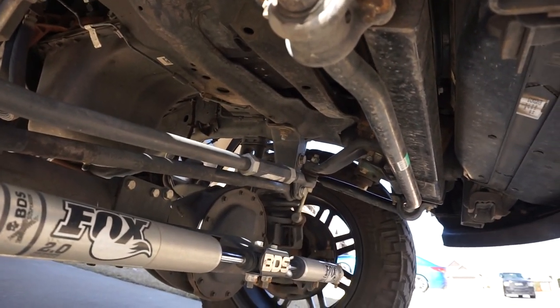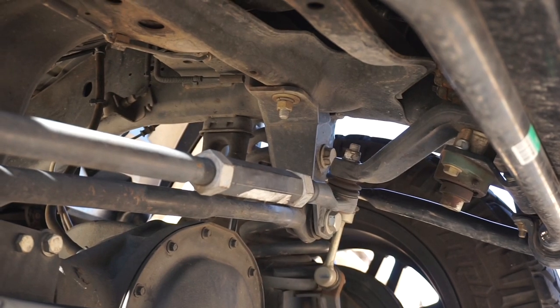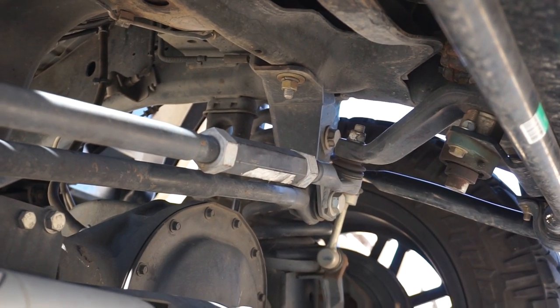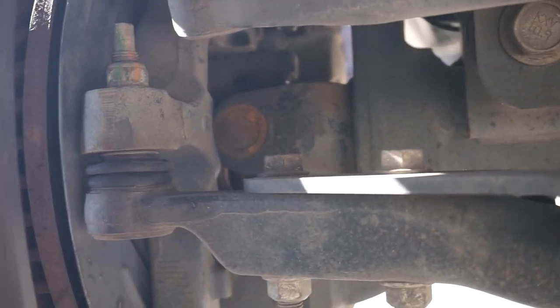So there's the drag link — as you guys can see right there in the picture, you can see how they welded it on, which is exactly what they do at the dealership. It's a very easy install; it's just a pitman arm bolt, and then over here it's just the bolt right there on top of the axle — just those two bolts, very simple. I'm not actually going to do the install on this video; we'll probably do it on our next video when Bodie's over here doing his u-joints and hubs.